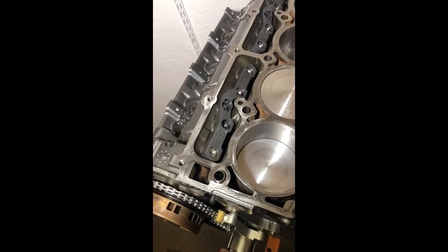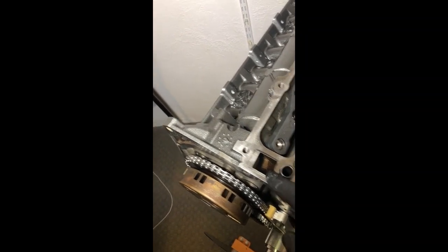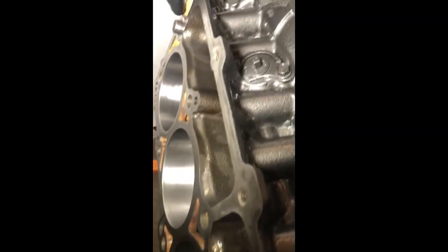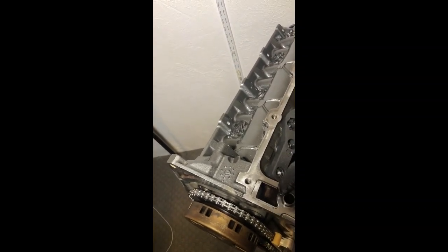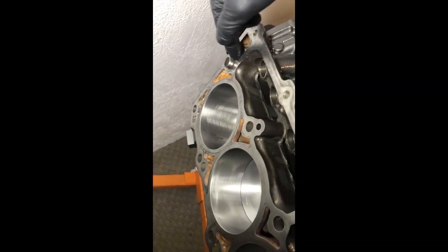I just didn't follow the orientation of these holes. On the head gasket, this side is just a regular square but then you have the curved side on the back. You have to make sure the two holes are oriented correctly — for the driver side, the gasket with the little curve on it has the holes on the back side. The passenger side is wherever the curved side has the two holes on the back as well.